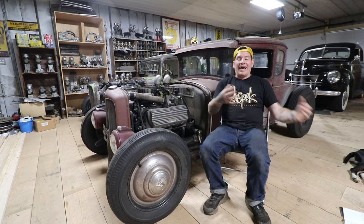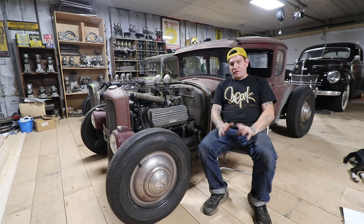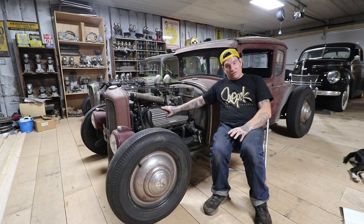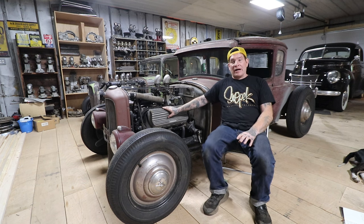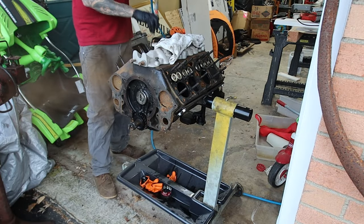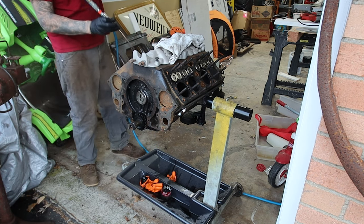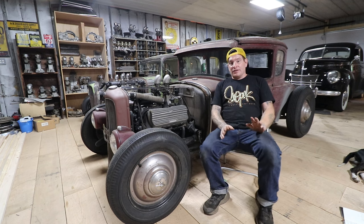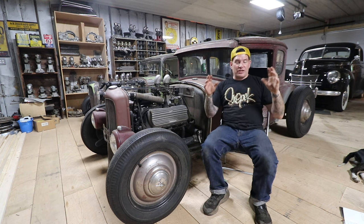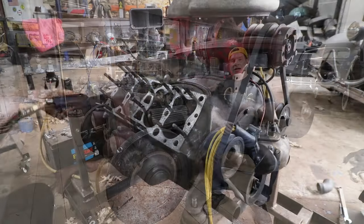Now if you're building a car and you have the flathead out of the vehicle, the thing I've found is by far the most effective - and I've even done it on this car here, which used to run relatively warm when I'd drive around. If you pull the cylinder heads off and pull the water pumps off, you can get in there with compressed air. Drain the cooling system, let it completely dry so there's as little moisture as possible, then get in there with an air nozzle and blow everything out. When it dries up, everything turns to dust and the particles can be blown out.